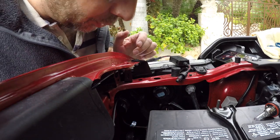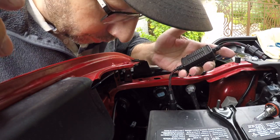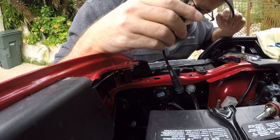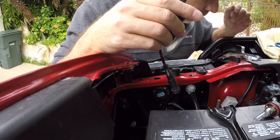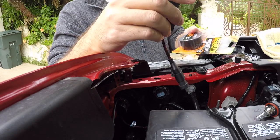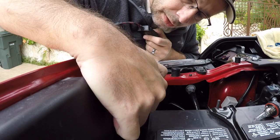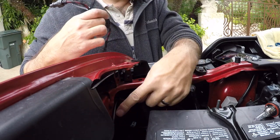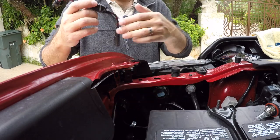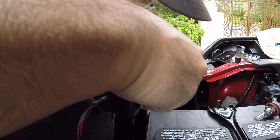The next part is installing the driver unit to the light bulb and the wiring harness, and then we're going to secure it to the side of the truck. The instructions say to use zip ties, but instead I'm going to use double-sided mounting tape — in this case Gorilla Tape — and fix it right here on the edge so it's nice and accessible and still out of the way.